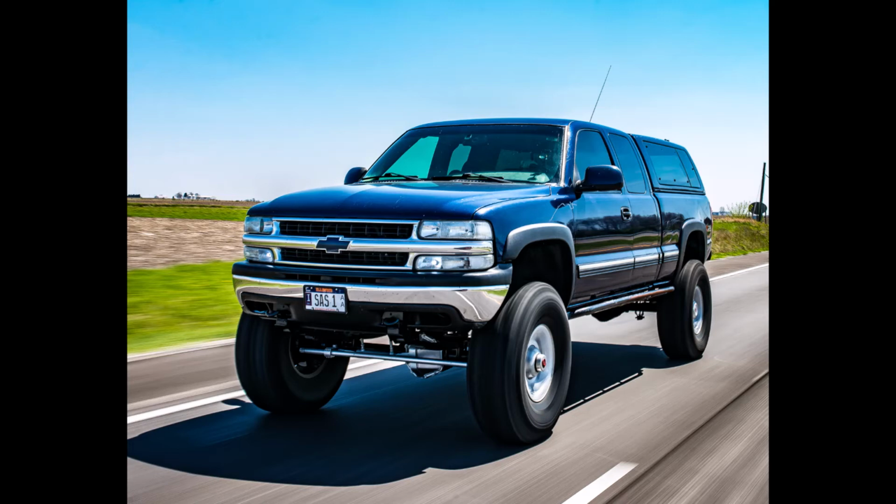I think the Trips are probably pretty good tires, but I don't know anybody who's actually run the radial Trips. The bias Trips are gnarly. That's my favorite tire right now. I can run a bias, but I can't run the sticky, because I was watching Bleep and Jeep, and he did a review on the stickies. He said at 32, anything under freezing, they start to crack. That's the bias too. I can't play that game. I was going to run the bias, like, screw it, I'll deal with the flat spotting in the winter, because that tire is just so badass. So beautiful. It's still my favorite tire. But I emailed Maxxis, because they say on their website you're not supposed to run them under 32.